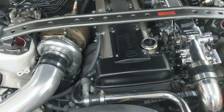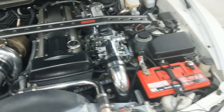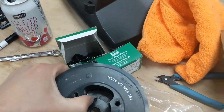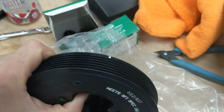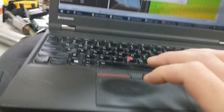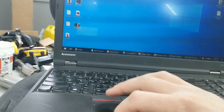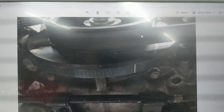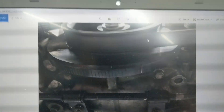The problem is we expected there to be one little mark on the crank pulley, and that's typically how a lot of cars are. This is a fluid damper for my 3000 GT and you can see it only has one mark. The fluid damper for the Supra has like 20 or 30 marks on it. I took a Sharpie and covered over every one that wasn't important — this is the actual mark. It's the first big one coming from that direction, so it's the last one in the chain.